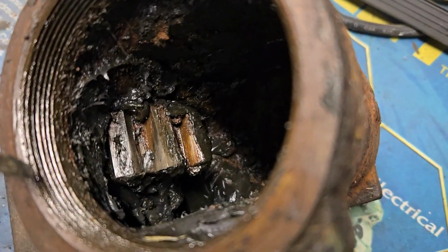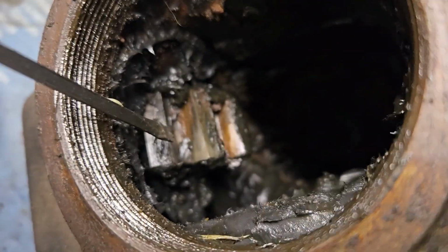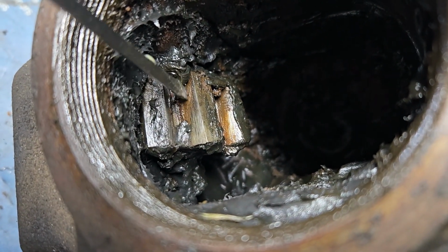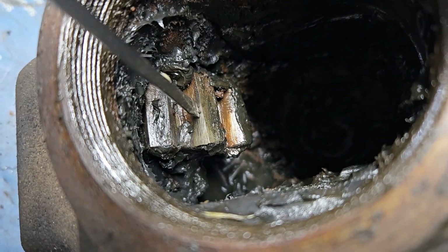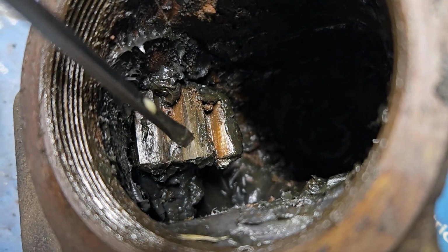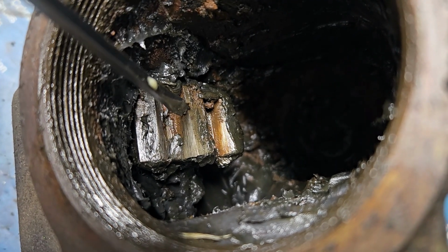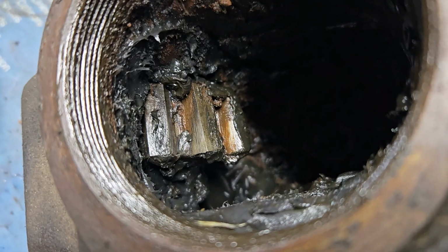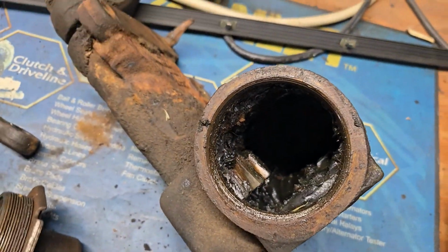This one, you can tell, had water sitting in it, and it's rusty. And you can also see the wear marks here in the upper part. And on extreme box wear, you're going to see that this is actually kind of scalloped and worn. That is wear item number 1.